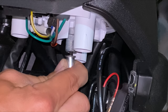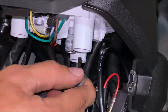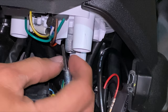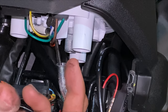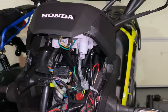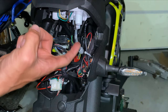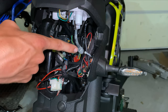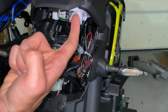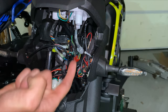They have this little tapered flat piece that has to sit flush when this screws down. All you do is pull it out — you can see that square ribbed piece, that's the master key, and this is what's pretty much murdering itself. You can push it in or pull it out a little more; it's attached to a cable designed to spin and is lightly greased. So all we're going to do is feed this down behind this black bar where it's stressed and feed it up on the other side, so rather than going around that bar it just goes pretty much straight up through the chrome bend and straight into the gauge cluster.